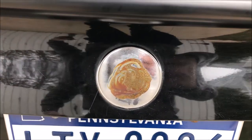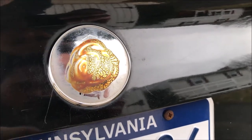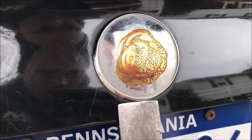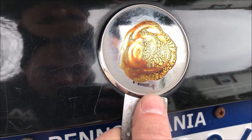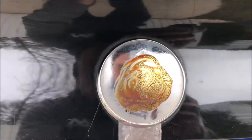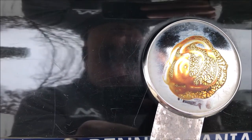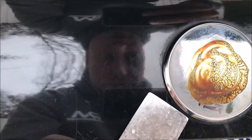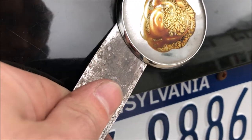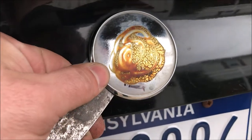I've heated this up with a hairdryer and you can try to use dental floss to go around and kind of saw at it to get the old badge off. But on this car I'm just going to use a putty knife — insert it and get underneath to cut the adhesive tape. Just want to be real gentle with this.